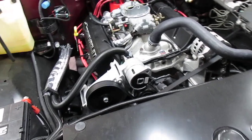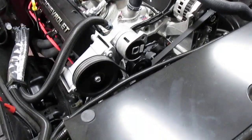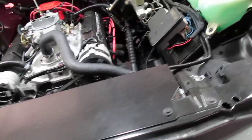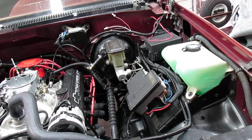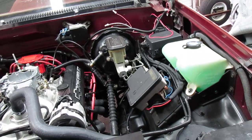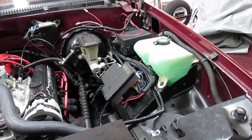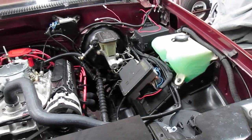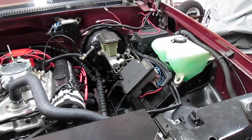Pretty responsive. Over here you can see the area where I took the TCU off. I'm going to put my new MSD one there in that same location. I've got the wires kind of pulled off because I'm going to be using the power feed — the white wire, for example, is a tach feed. The new one still needs a tach feed and, of course, power and switch power. So I just left that until I get the new controller.